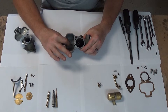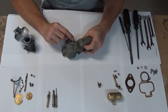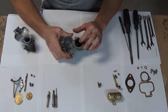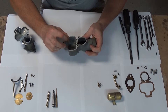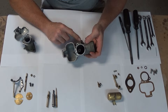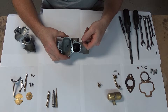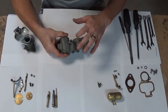So let's follow the main jet. The fuel goes down through the main jet, comes out this drilling here in the bottom, and from there it actually gets pulled up the jet. This is very similar to a Stromberg — it actually gets pulled up through here along with some air and ends up in the venturi going into the engine. At the same time, fuel can come from the bowl, go down into the enrichment needle into this channel, and then depending on if you turn the screw out on the enrichment needle, you can add more fuel to the bottom here which will go up the main jet.